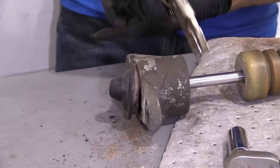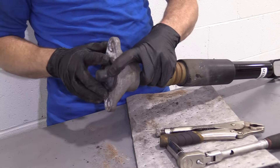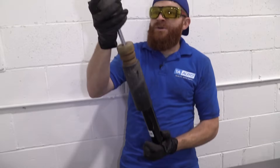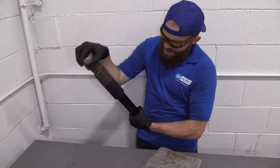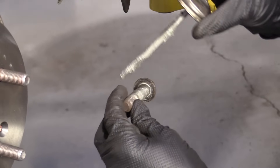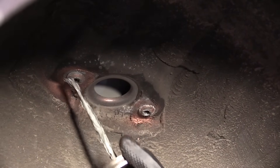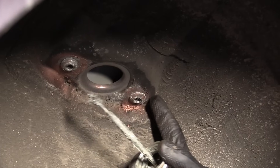There we are. You want to make sure that this is closed. When you get it up in the body of the car, it will sit down there — it's going to be hitting up against the body, so it'll be pinched nice and shut. So this spins, just so you know. When we go to get into the vehicle it's going to be like this — you might have to just compress it to get it between the knuckle and the body of the car. This is the lower bolt for the rear shock. I'm going to put a little bit of never-seize here on the threads. If you wanted to put something on the threads, you can also put a little bit of thread locker. Up here I'm going to use a little bit of never-seize — not too much. Just enough so someday if I ever have to take these shocks back out again, they won't break up in the body. And by super fun, I mean not fun.